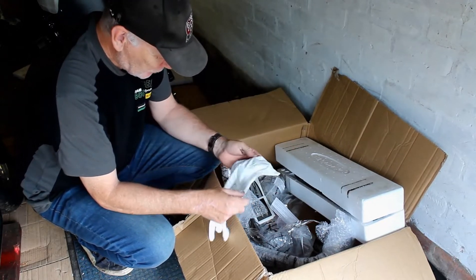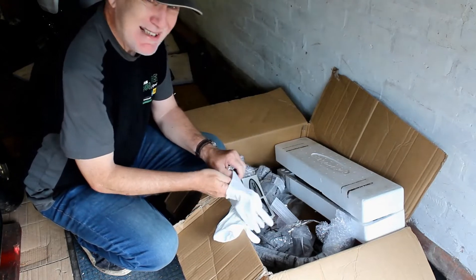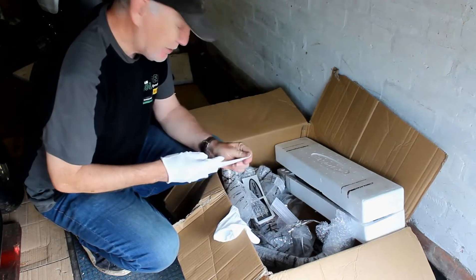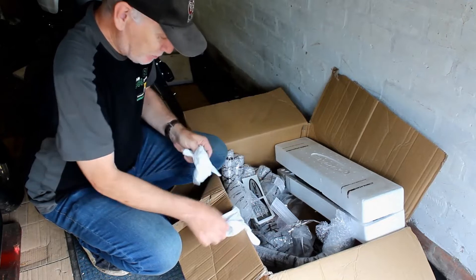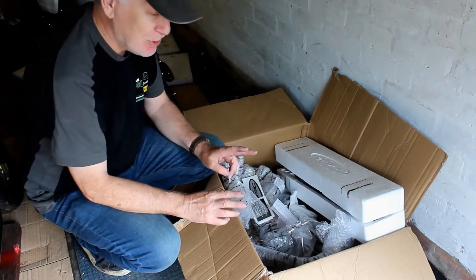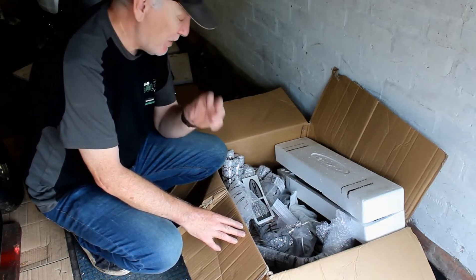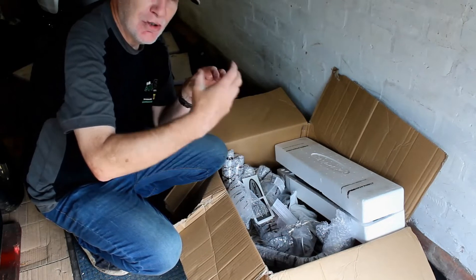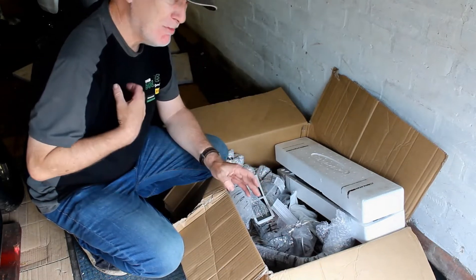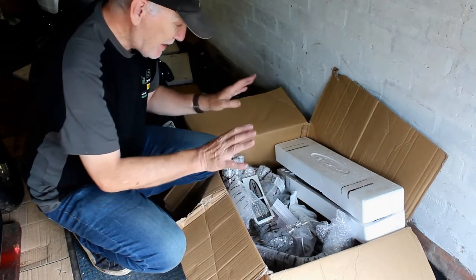They even include a pair of white gloves. That's because when you've got a brand new exhaust pipe, you really need to clean it very carefully before starting the bike for the first time - otherwise you can permanently mark the exhaust pipe. Going through everything, I've realized I'm short of split collets that go behind the collets holding the exhaust pipe to the head - eight parts needed. I've ordered them from Zed Power at about £3 each, and they should arrive in a few days.